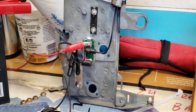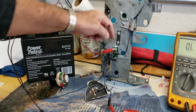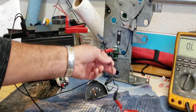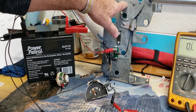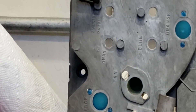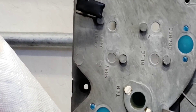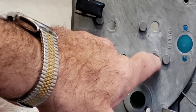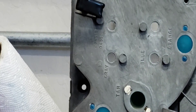I'm drawing 12-volt positive off of a battery. 12-volt positive goes in here, powers the limiter — the output goes to all the gauges, and I'm jumping off that to the positive terminal of the gauge. I just put the gauge in the cluster. On the backs of these clusters, it's color-coded — this is gray, that's blue. Those colored ones are the ones that go out to the sending unit. The unmarked ones are the power source. Put the gauge in the cluster and you'll know right away which is your power and which is your sender. Mark positive on the back of your gauge so you know which one is power when you go to calibrate.